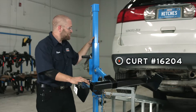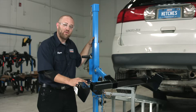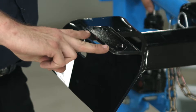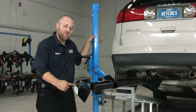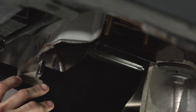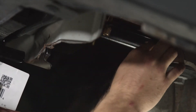Alright, the hitch is up on a U-Haul exclusive hitch jack. If you don't have one, it's a good idea to get an extra set of hands. The mounting locations are identical on each side — there are two here from the bolts we just fish wired up, and this one is where we're going to drill into the rear body flange. Let's get the hitch into place. You can lower the exhaust for ease of installation, but for now we haven't. Make sure when you put the hitch in place not to push the bolts back up into the frame rail.